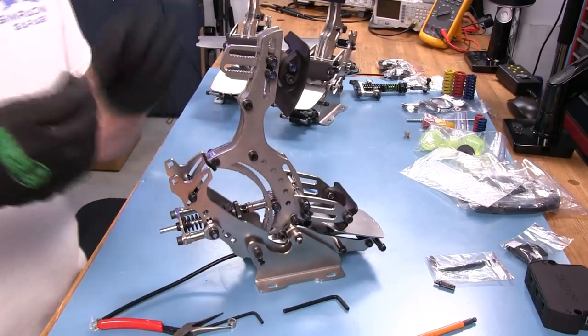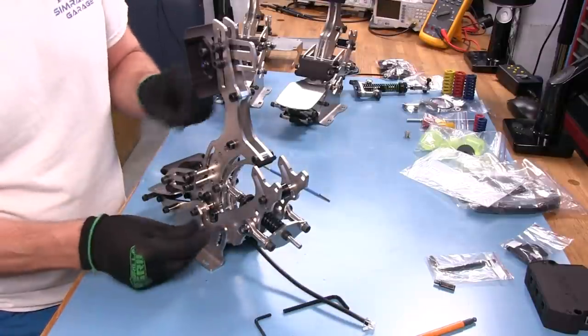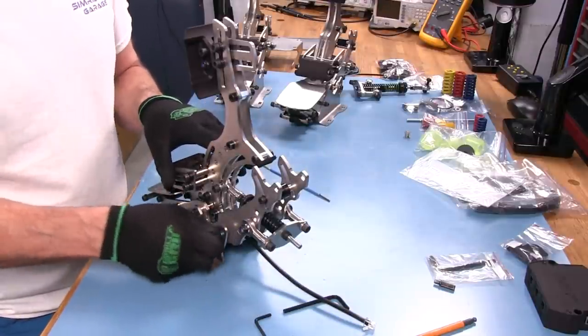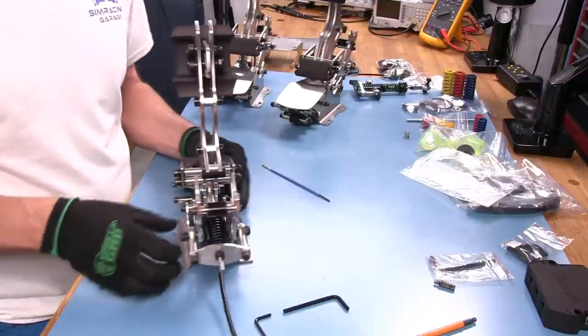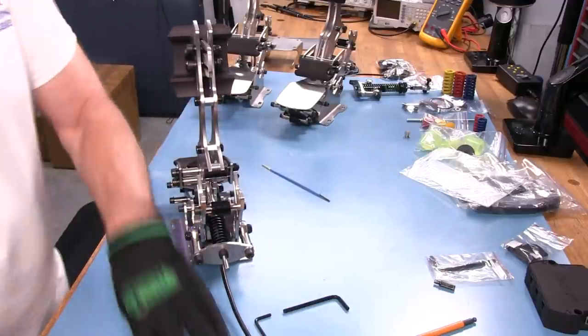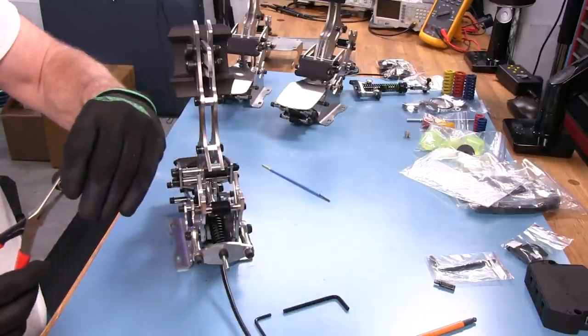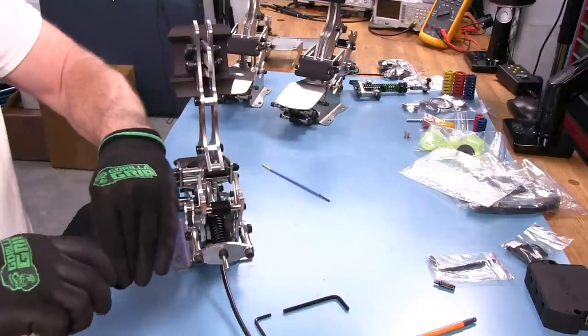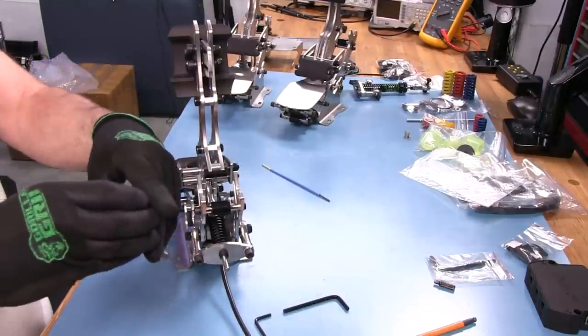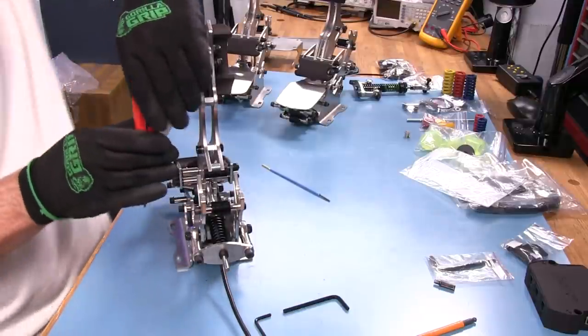First, I'll make sure my bolt is lined up in the hole properly with the threaded part. Because the last thing I want to do is have that spacer in here and fishing around for the hole. So make sure that's lined up first. And again, not that difficult, but it is the most finicky part of the adjustment, the angle adjustment. And that holds true with any of these pedals. And I think that, yeah, they all have the same angle adjustment. Haven't been over messing with those yet, so I had to look.